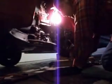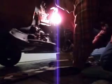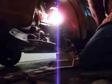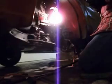And once again, this one came off really easily. Usually, once I put this back together yesterday, you can imagine I only had 2 miles of driving on it, so the mechanical weld didn't really have a whole lot of time to sink itself in there and get stuck, so it came out pretty easily. Now we're going to take off the pinch bolt off the strut.